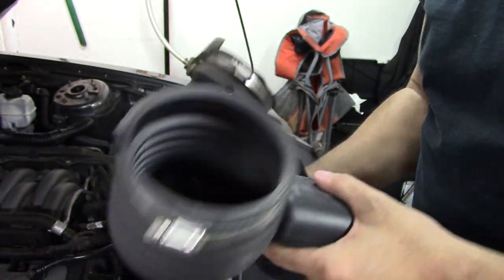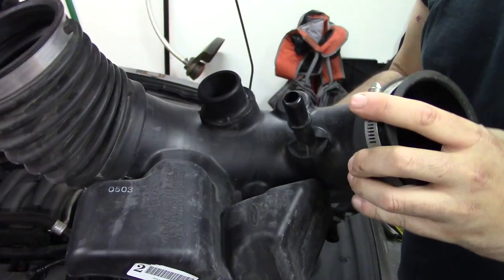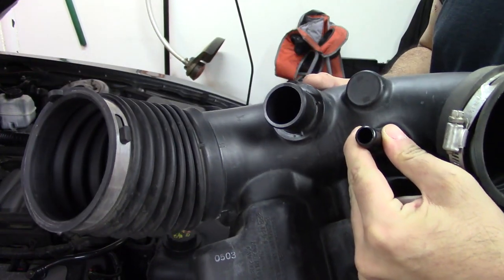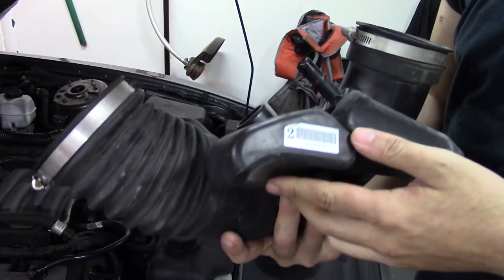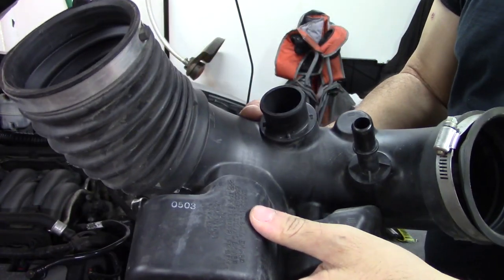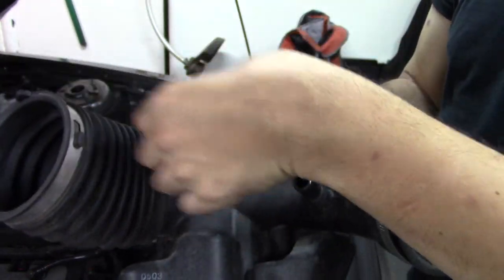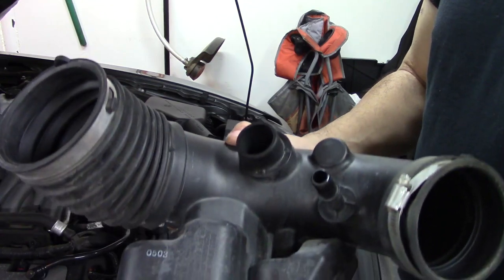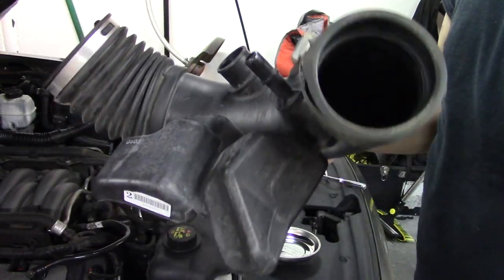So this is the air intake, airbox side, throttle body side. This goes to the PCV, it's a recirculation, and this is for the sound symposer, and then this is what enables the sound symposer to get that throaty sound. Air goes in, kind of tumbles around, and what comes out of the tube goes into the car. You can replace these with cold air intakes, doesn't really give you much power, but you can.